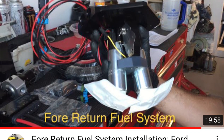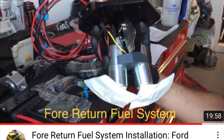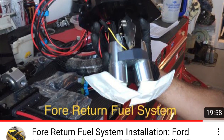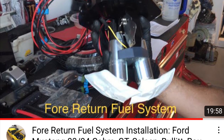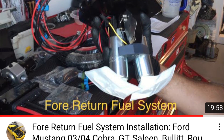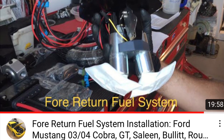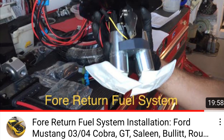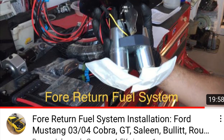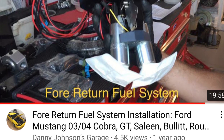I'll put links to those videos in the description. Just wanted to show you real quick what this was. Basically, a fuel pump driver module is driving the fuel pumps, and once you add a boost pump and you're trying to get more fuel to your engine because you've upgraded or added a supercharger, that's when you would have to upgrade the fuel pump driver module — or the car could go into limp mode or start to cut out. Put in the comments what system you're currently running. If you're new to the channel, feel free to subscribe, and thanks for watching.